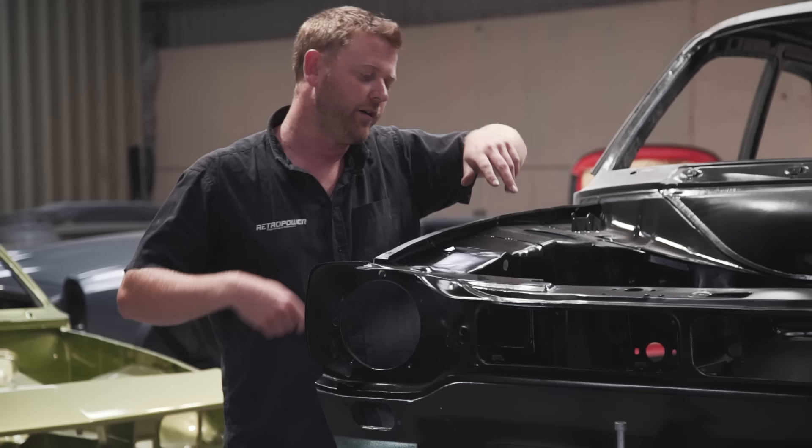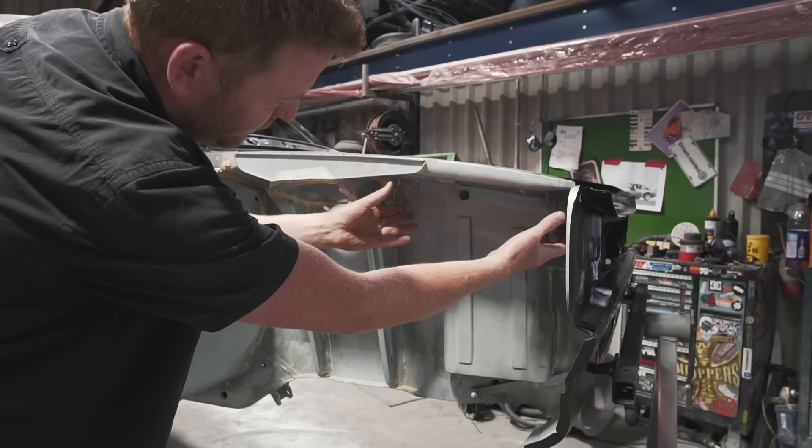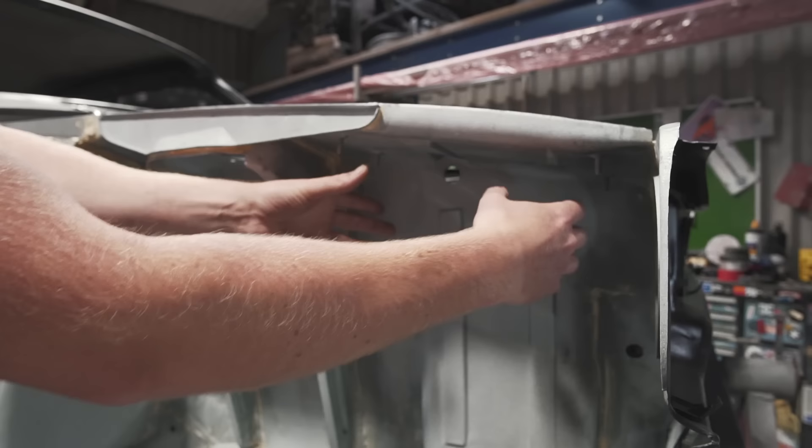The inlet — the return oil to the tank — is actually under here, and the pipe comes straight out 90 degrees down to the cooler. We've already planned the pipework and got holes in the bulkhead panel for where it routes forward. The outlet from the tank shoots straight across behind the radiator. The vent pipe goes out through the inner wing, and we've got four studs on the underside of the inner wing which will mount a breather tank in one of the few remaining available spaces above the wheel and behind the headlight.